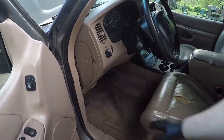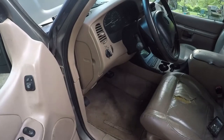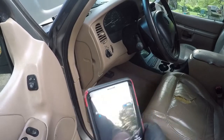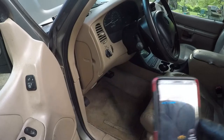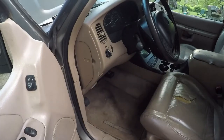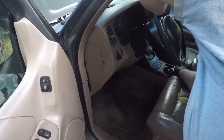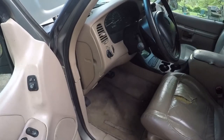So what I have plugged in down here is a little OBD2 sensor. It connects via Bluetooth to your phone and uses the Torque app on your phone. Bring that up. Link will be in the description. I've used this on my car and this vehicle several times. It is definitely worth the investment. This is the tool that I used to figure out it was actually the camshaft sensor.